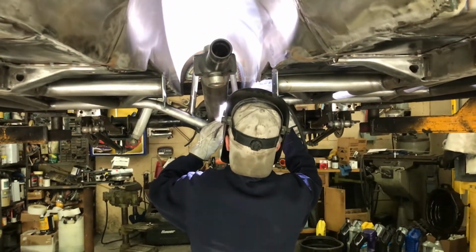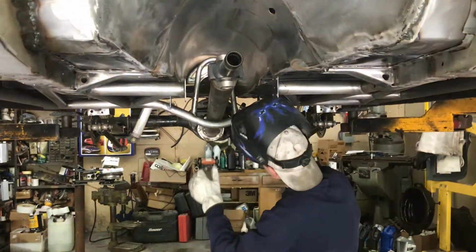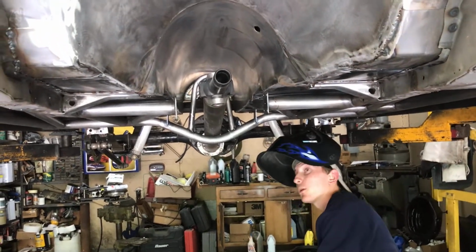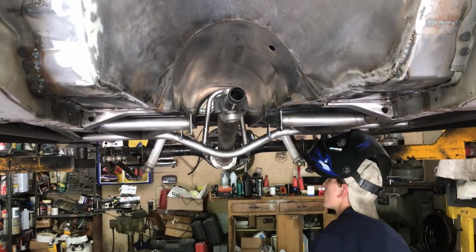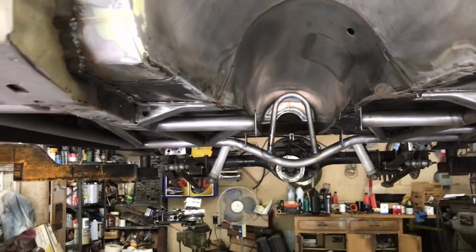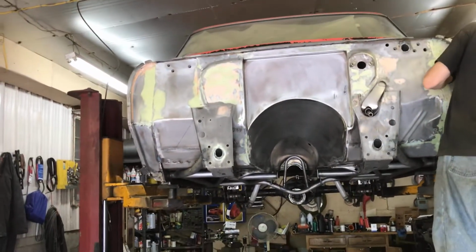Spread it out a little bit, just in case you go with a 4-inch deal, or aluminum, or carbon fiber later. All right, move it out of the way. But it's good. I gotta take the driveshaft out so we can weld it all the way around. All right, driveshaft loop is welded in. Gonna sand that little spot around where we welded, and we are ready for primer.